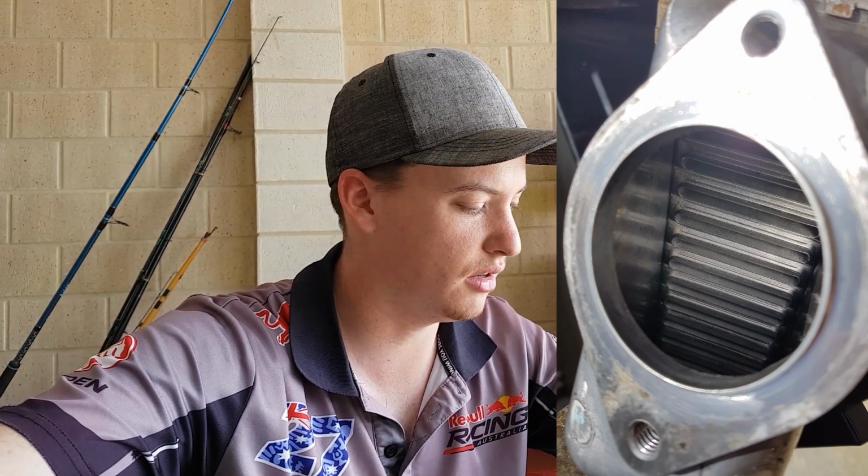So before you go out to do your full driving, jump out there, get your car cleaned up, lower EGRs at the same time, and make sure you maintain that engine of yours, because these direct injection diesel cars can have massive problems with oil blow by and that kind of stuff. That's why I put catch cans on it, and that's why we do all these things to save them. But if we don't do these simple service things, then there's no point in doing the other stuff.